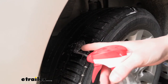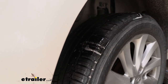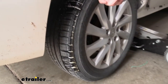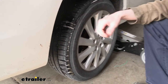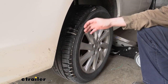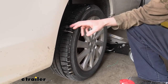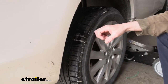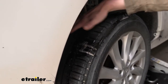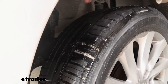Just check around and look for any nails in the surface. If you see it in the tread surface of the tire like this, there's a good chance it's repairable. If it's on the sidewall, unfortunately that tire is not going to be repairable — the sidewall has too much flex in it. A plug just isn't going to hold; it'll eventually work its way out because of that same flex. It also cannot be patched, so that tire is basically junk and needs to be replaced. But where we are here, we are in the tread of the tire, so it can be repaired.